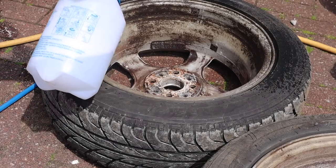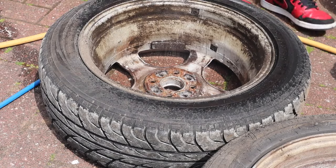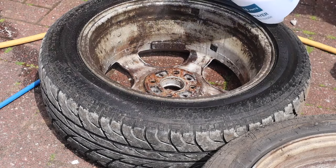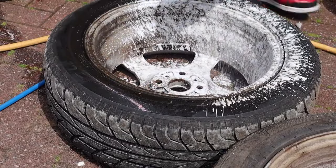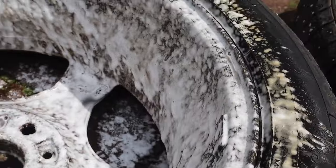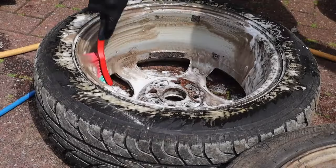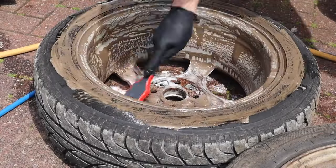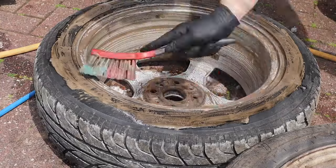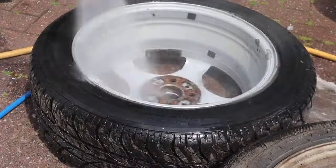The first thing you're going to want to do is get the wheels off the car. As you can see the barrels are extremely dirty, so you want to go in with a decent wheel cleaner and try and get them as clean as possible before you start doing any sanding. I'm using a wheel cleaner diluted at 4 to 1 in a spray bottle, and then I'm using an IK foamer over the top just to give a bit of lubrication to aid with the cleaning. Then giving it a scrub with a Vikan brush before giving it a quick rinse down — you can see the massive difference that it's made already just by using some chemicals.